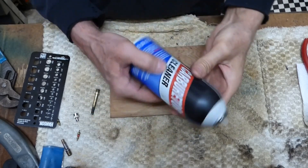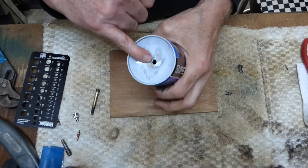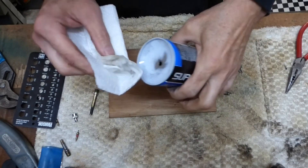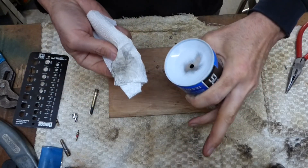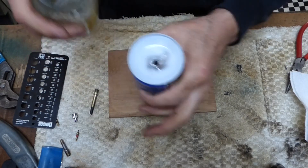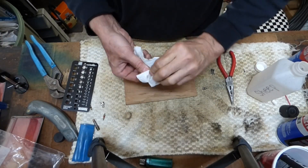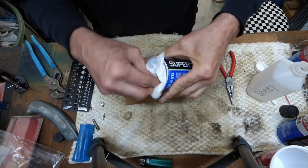Because this can originally held carburetor cleaner — it's very, very flammable — I'm going to go ahead and put some water in there and rinse this out, because I'm going to work with heat to solder this. I want to clean this off first. Just put a little water in, rinse that out, and dump it out. Now I'm just going to wipe this valve stem off again with some rubbing alcohol and our can also, with all the water out of it.